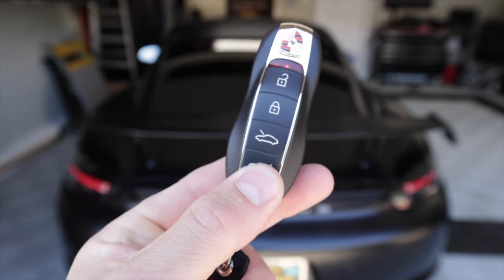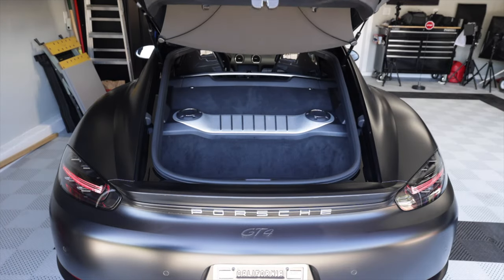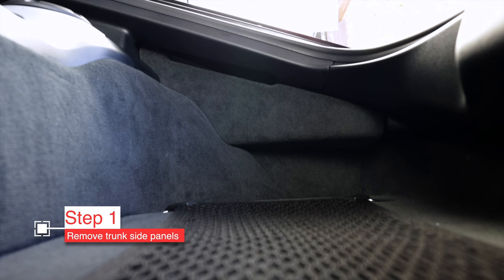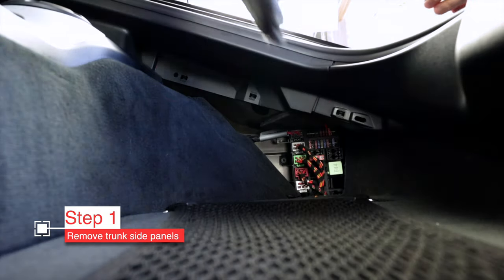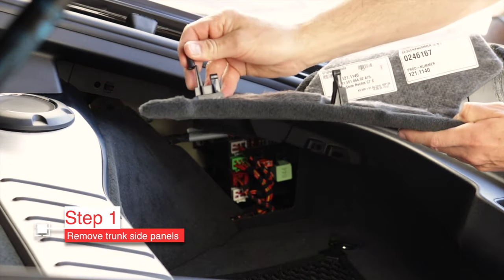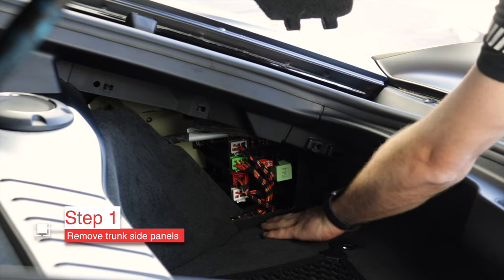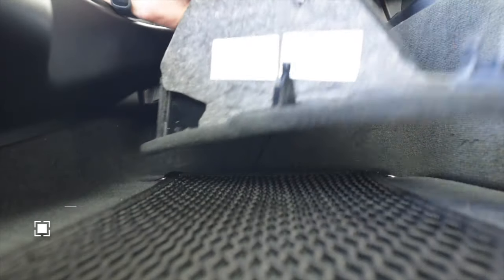This job has a lot of steps, but just take your time — it's all pretty easy. You shouldn't have to worry about breaking any plastics. Sometimes a clip will separate or you'll drop one, but you can get those at your local Porsche dealer for cheap. Let's remove these two inner panels of the rear trunk. They're meant to be pulled off because there's electronics behind them — just grab at the top and pull out. You'll see clip slots and little cone holes. Those cone tops sometimes stick in the holes, so just keep track of them.